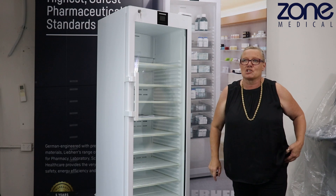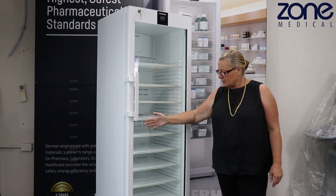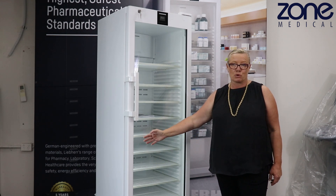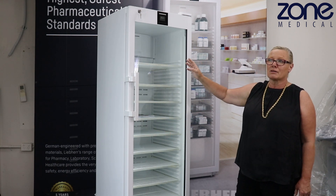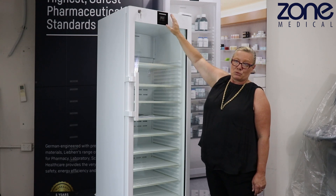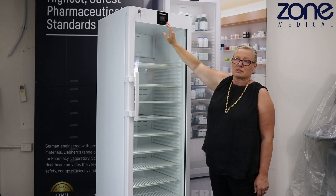The display is now showing the ambient temperature in the fridge, which will slowly start to come down. There is a new LED light going down the side of the fridge — if there is an alarm or the fridge door has been left open too long, that light will flash. It will also show a big red symbol on the screen indicating whether it's a temperature alarm or a door alarm.